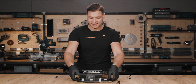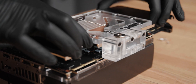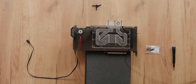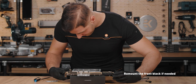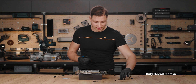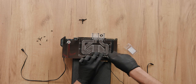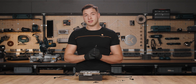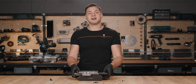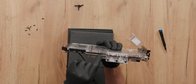Now we can finally install the active backplate. First, remove the three remaining screws in the terminal and again make sure that the O-rings are in place. Then slowly place the active backplate onto the block. Make sure that the RGB cable isn't interfering and that the holes are perfectly aligned. Next, we start by inserting the screws into the active backplate — do not fully tighten them at first, just place them in. Now fully tighten these screws in a cross pattern. Check that the active backplate is resting on the PCB; screws must be properly tightened and thermal pads properly compressed. You can see that the standoffs are touching the PCB from both sides.